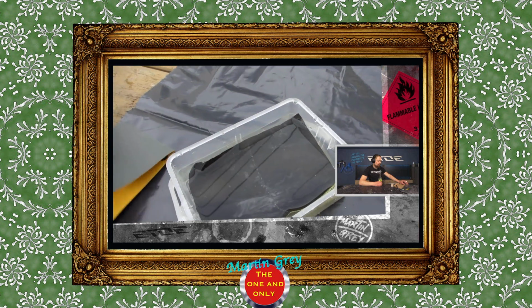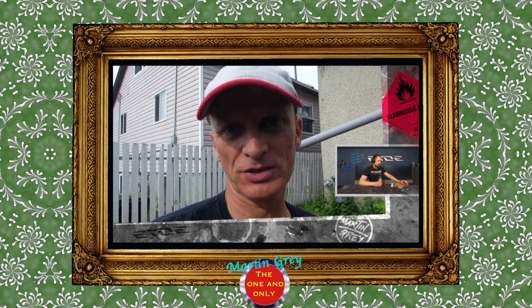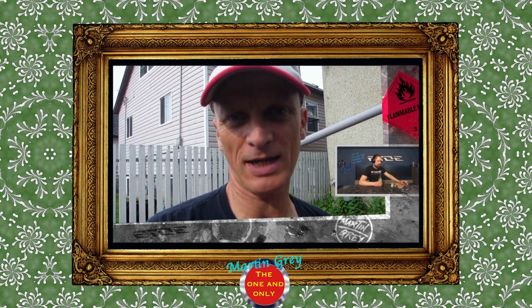The other one in the water there is 600. The point is just to get the glaze off the primer so that it's more tacky. Yes, that's right. If you sand the primer, you get a tacky surface for the next layers. I recommend an 800 grit. 800. Thanks for the tip.